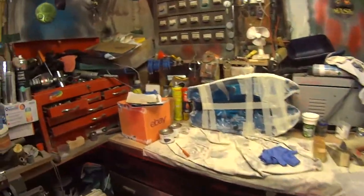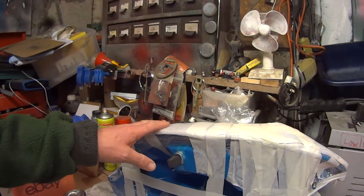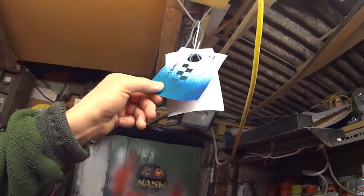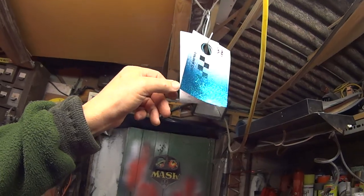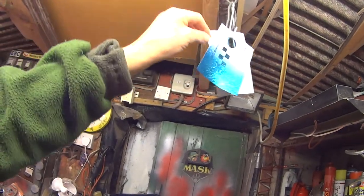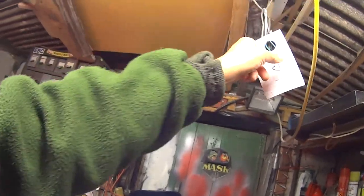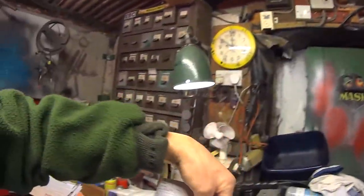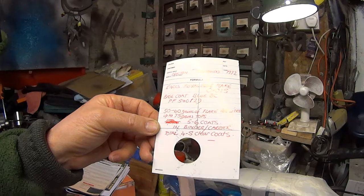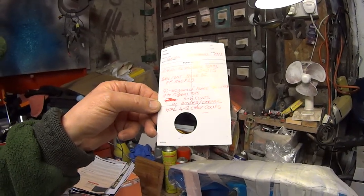At the moment I'm just doing the tank. It's all sprayed up. Unfortunately I sprayed it before I realised I needed some sealer inside it. So it's this colour here, which is the metallic blue — you can't see very well but it was quite a tricky job to do. There's some interesting information on there perhaps for somebody who's doing these colours. Norton Commando '72, Earl's Royal Blue Flake 0.015 — I got that from a really nice guy who gave me the information about the flake.